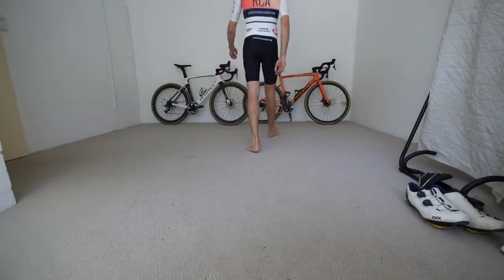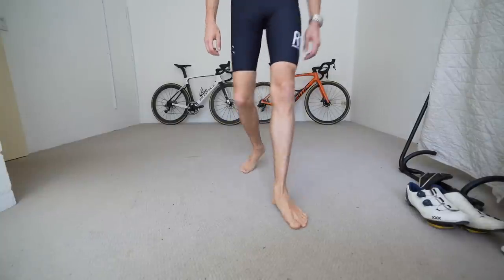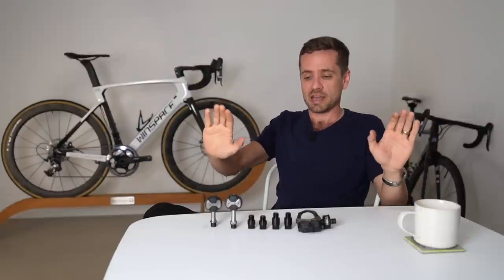In addition, if you walk with both feet turned out — clients always say to me 'I walk like a duck' — with feet externally rotated and heels in. If you walk that way to quite a strong extent, there's a good chance that when you look down at your feet while riding, your feet will also gravitate towards a heel-in position because your hip has evolved to operate in that rotatory range. Those people very often benefit from moving their feet further apart, because when feet are externally rotated on the pedals, it artificially narrows the Q-Factor that their knees and hips see further up the chain — sucking everything in towards the frame artificially.